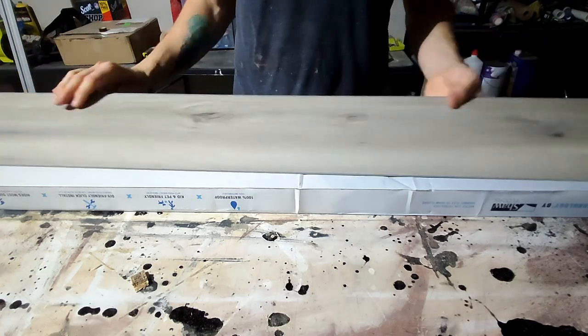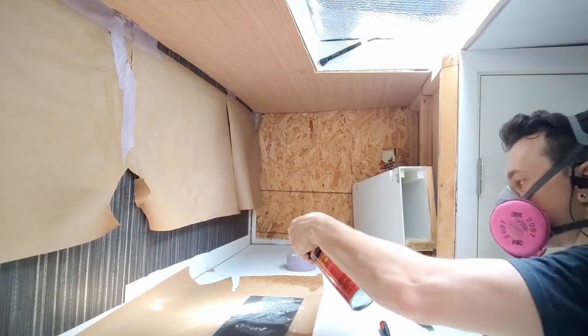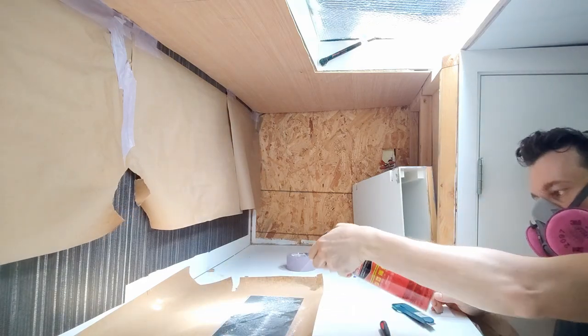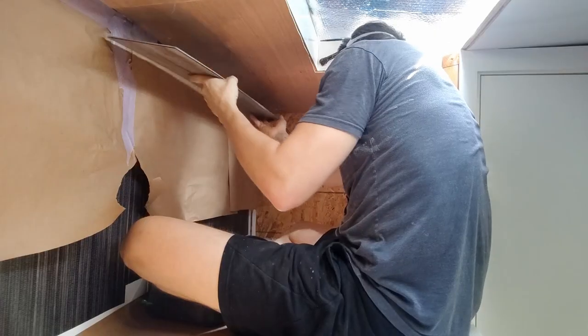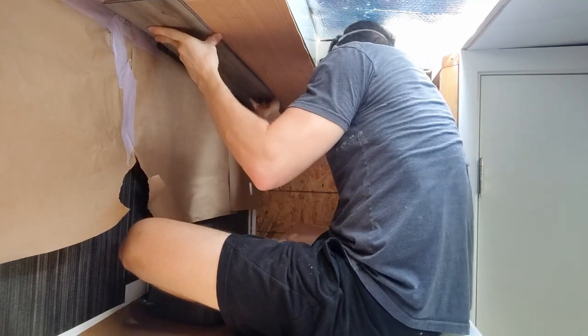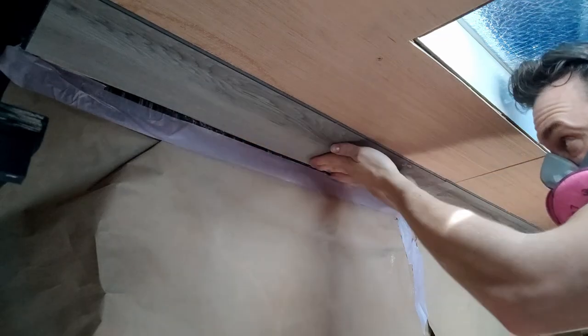We're going to use luxury vinyl planks for these, because I like to choose the most expensive possible materials I can, apparently. But these are gray luxury vinyl planks. They're very thin, they're flexible, they don't have all the extra added doohickeys on the bottom, you know, the extra padding and stuff like that. I want it to be thin because I need every millimeter of space that I can get up in this bedding area. And all we're doing with this is contact cement. Spray contact cement on the ceiling, spray contact cement on the tile, and stick them together. Rinse and repeat.